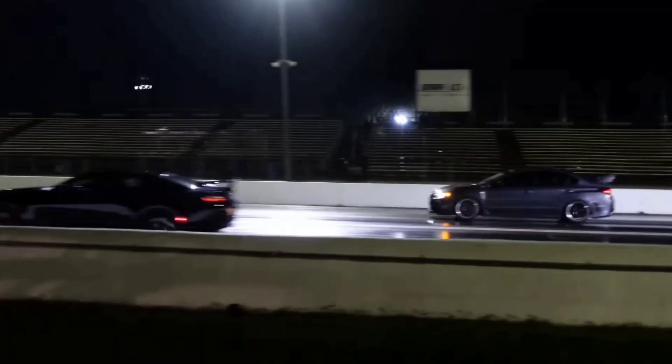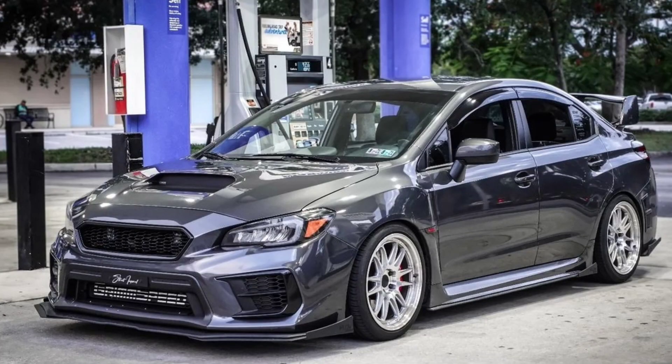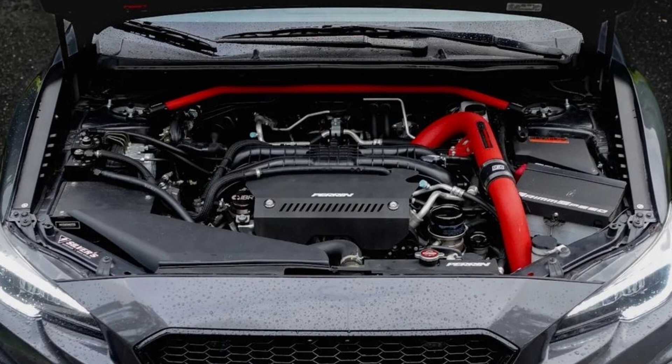This thing is literally funny — it's making serious power. My VA WRX was advertised at 403 wheel horsepower, but that was like a full-send map where the car would probably blow up. On its regular map it was making 372 wheel horsepower — and now I'm making 387 in this car. My old WRX had TGV deletes, EGR deletes, front-mount intercooler, intake, boost control solenoid, turbo inlet, flex fuel kit, low-pressure fuel pump upgrade — all that stuff. This car is completely stock on the stock high-pressure and low-pressure fuel pumps, which are both apparently ethanol rated and should be good to 100 ethanol.